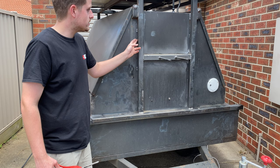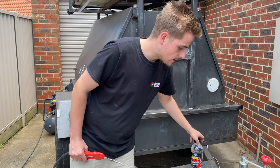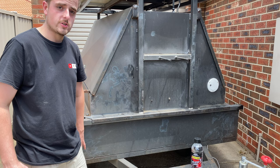So what I'm going to do now is air blow all this down, and then I'll wipe it down with some of this wax and grease remover. And then I've got a little bit of this seam sealer, Sikaflex stuff that'll dry up in the tube, but I've gotten it to work, so we'll whack some of that in there too. And then all I'm going to do on these parts is just wax and grease remove and use that etch primer, and then I'll be right for Raptor liner.